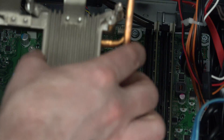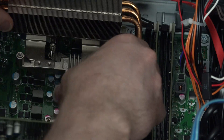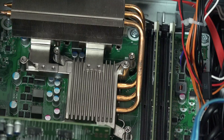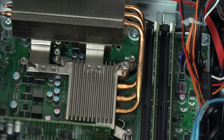In order to install this cooler, the fan has to be removed first. I'm going to make sure that as I'm bringing this down over top of the thermal compound, I come down as straight as possible so as to not smear it all over the place. Now we can start to tighten it down. When you do this you want to tighten from corner to corner just to keep it all going down evenly on the thermal paste. There we are — she's in there. Now that that's on, we can install the fan.